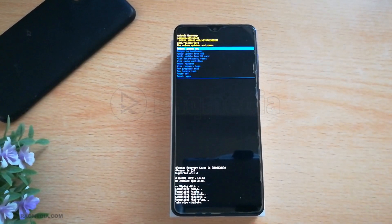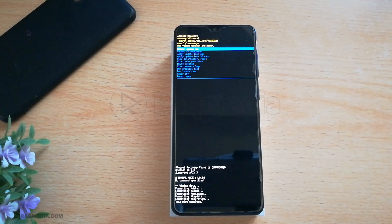After the reboot, your Samsung Galaxy will be completely reset — just like the day you first bought it. If you had a Google account synchronized to the phone before the hard reset, you may be asked to enter your account and password in order to bypass the activation screen. Otherwise, you will have full access to your phone without any lock screen pattern or passwords.